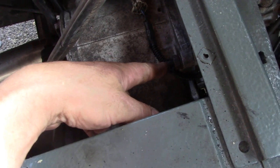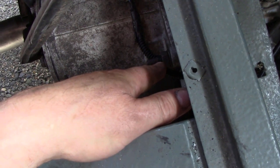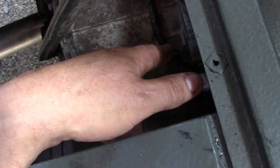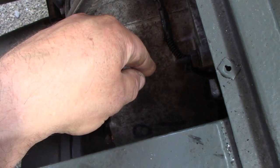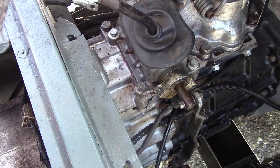This pin here is a very important little pin - look down there - because with the handbrake on and the transmission all complete, you can put a chain on there, and that is its nice balance point. When you pull that gearbox off, everything will balance together. So you can put a chain on there, pull the gearbox off, and then drop it down on the floor. You can use an engine crane - that'll pull it off. That's an easy thing to do. But I'm going to go in the shop now and show you my lift and transmission jack.